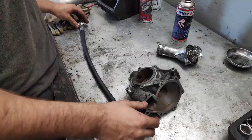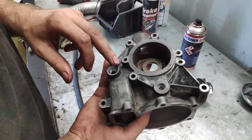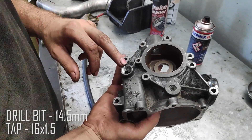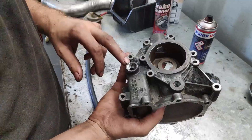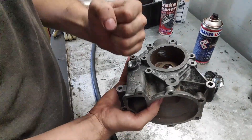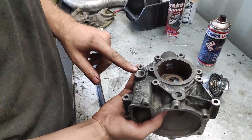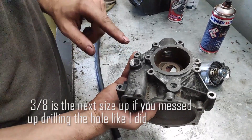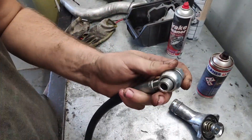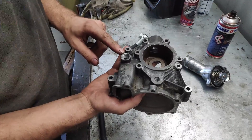To start, you need to drill a hole right here through the water pump housing. Take your drill bit — it's a 14.5 millimeter drill bit — drill a hole and then tap it with a 16 millimeter by 1.5. I did this incorrectly at first; I couldn't cut a thread because the hole was too big from the drill bit wobbling. I fixed this by drilling a 3/8 hole instead. Ideally you want a 16 millimeter hole, but a 3/8 will also suffice.